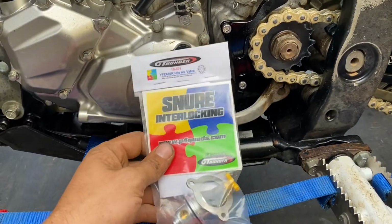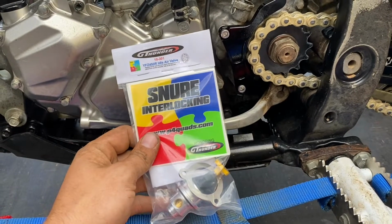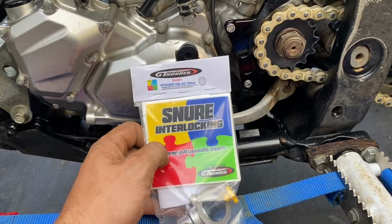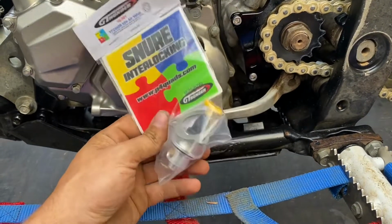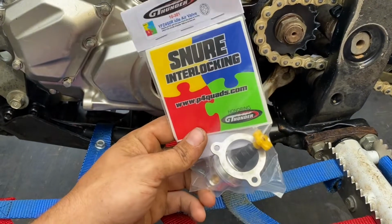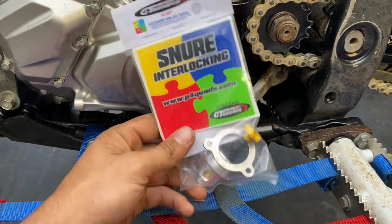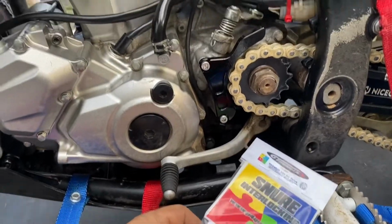Highly recommend, especially if you're racing in environments like myself up here in Washington State, where sometimes it's 30 degrees and other times it's 100, depending on the year. You're going to need to play with this. I don't know if you necessarily have to use the choke feature of this, but 2 clicks either way will make a big old difference.